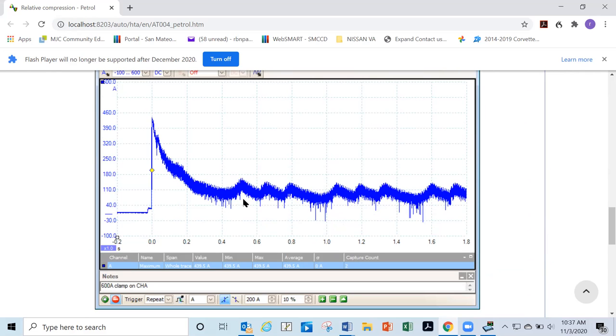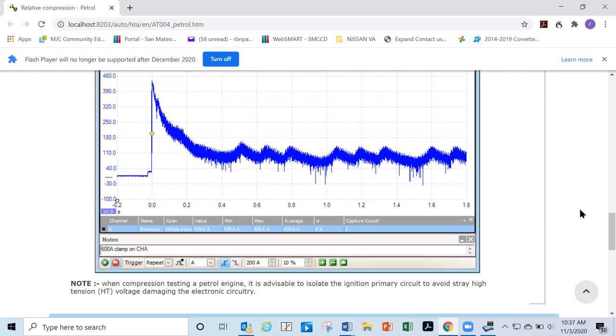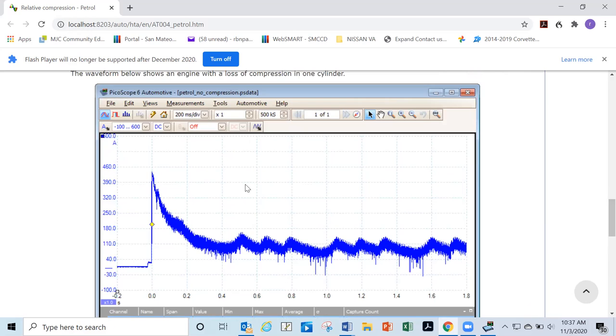And to figure that out, I'd have to go to my channel B. So I'd have to go up here and open my channel B, right up here, and then simply apply that channel to sync the cylinder. And I would sync it to number one, right? I'd sync it to number one by putting the leads, positive and negative. Let's start with the negative. I'd put the negative on any good negative ground, right? Any ground. And then I'd put my positive on the negative side of the coil.